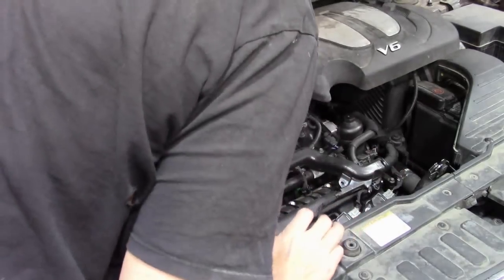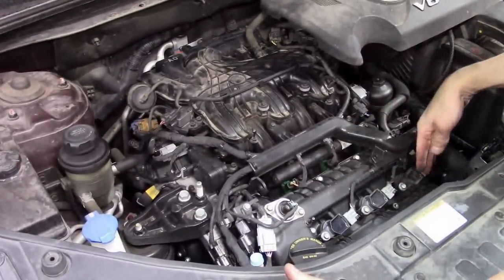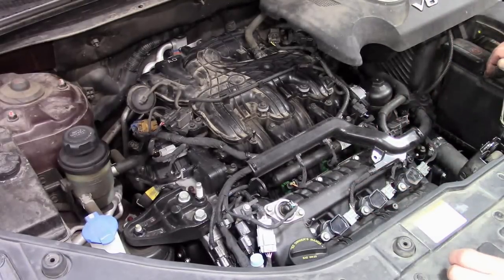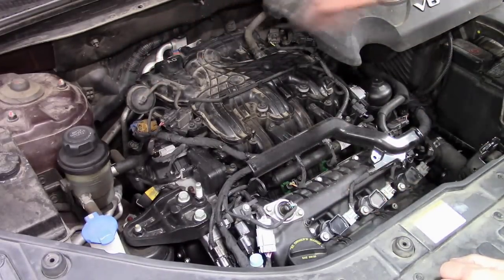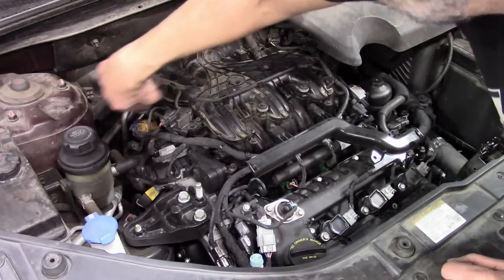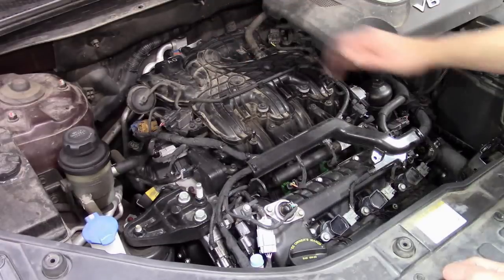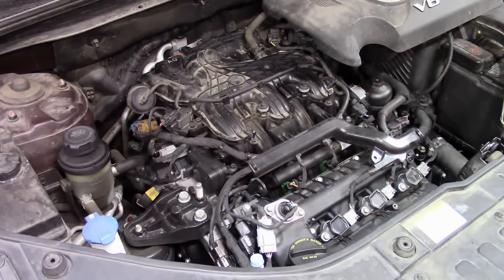One variable is that this car may not start right now because we have a fuel pump issue. Looking at the engine — it's a 2011 or 2012 Sorento — this is exactly the design I'm talking about. It's a V6, with three coils easily accessible up front. You might be tempted to pull a front plug, see that it looks new and has the right gap, and assume the plugs underneath the intake manifold were also changed. From experience, that is faulty thinking. We can use technology instead — running a probe under there through the intake runners to get a spark signal and estimate gaps.